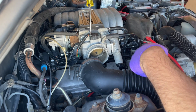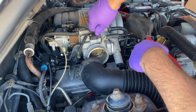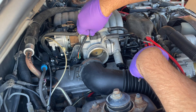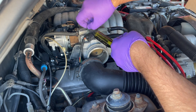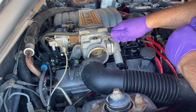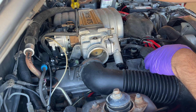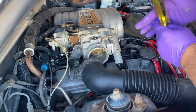I really think the TPS is going to be my problem — I hope it's nothing major. The EGR valve has some black on the outside of it. I hope it's not bad. Something else I need to check is making sure all my injector plugs are in — they can come loose sometimes and not run right. Let's take these hoses off: the vacuum hose and coolant hose. I'm taking it off on this side; this circulates around the throttle body. The EGR may drip a little bit of coolant — that's okay.